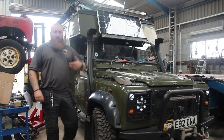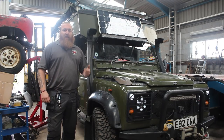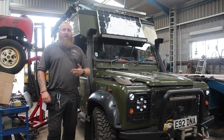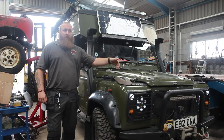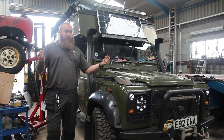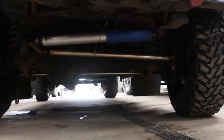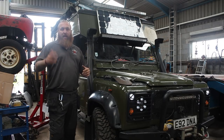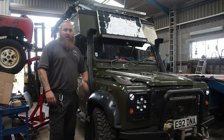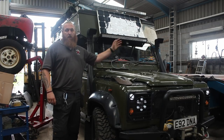As we're going round — with it being a rolling restoration — there are a lot of parts on the Land Rover that aren't great quality, but there are good quality aftermarket parts. The steering bearings went on the ends so everything's been replaced with heavy duty. Same with the brakes — they needed the pads replacing so it got bigger discs, calipers, better brake pads. All new braking system, new steering system top to bottom.